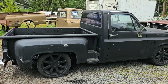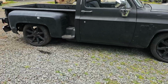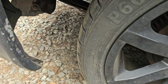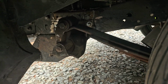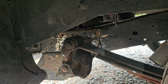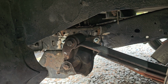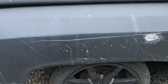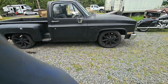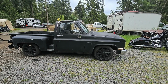Alright, now that I pulled out all my hair, had this thing back on the rack. Actually, this thing was really screwed up, and I found this out last minute after I dug the grease and grime off. These spring perches had been moved up. If you can see the existing, they were up about 2.5 inches. Really messed me up on the lowering on this thing, but long story short, let me zoom out a little bit. We actually came out with a fair outcome.